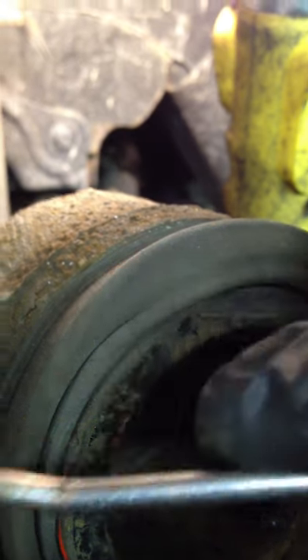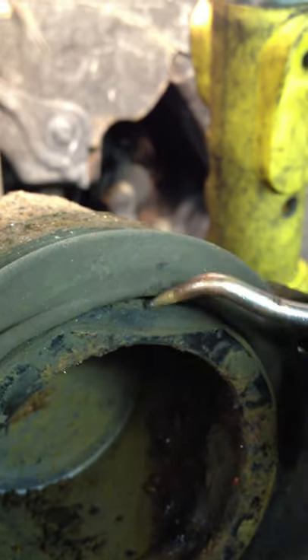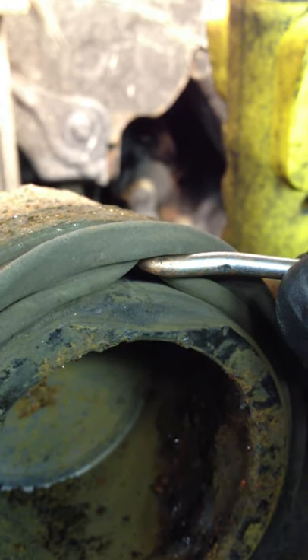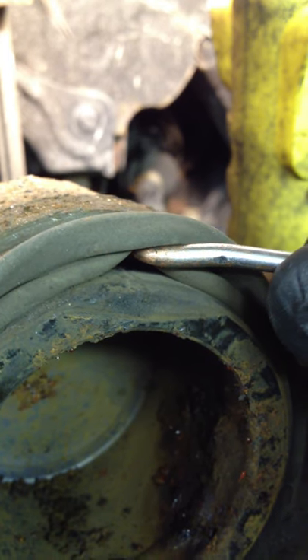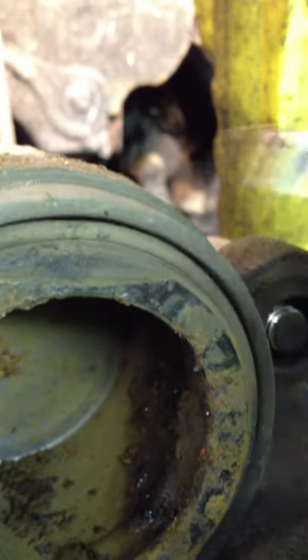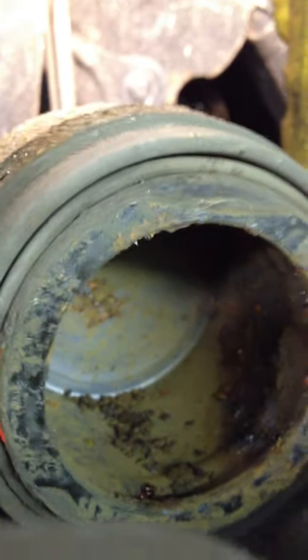It may or may not run across this. See how it's all poofy? Instead of folded over nice like that, it's because there's air trapped in there. You just need to stick a pick or whatever closer to the piston, not to the boot — you don't want to nick the boot, it's just a dust boot. Lift up, you'll see it come out of the groove, the air comes out, and now it folds nice, out of the way of the piston contact area.